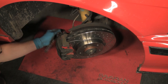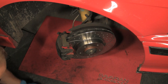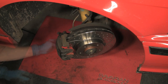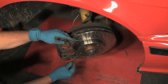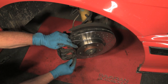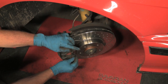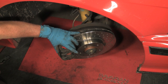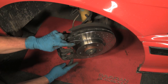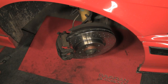Tighten both guide bolts nice and snug, then replace the plastic caps. Here we have our anti-rattle clip — it installs with the outer tabs against the bracket and the inner clips aligning with the holes. Put the outer tabs against the bracket and simply squeeze it into place. Sometimes it'll go by hand just like that, or we'll use a single pry tool to pry it into place. Don't try to put the holes in first — have it on the outside on the bracket and pry it down in. And that's all secure. Mount the wheel and move on to the next side.